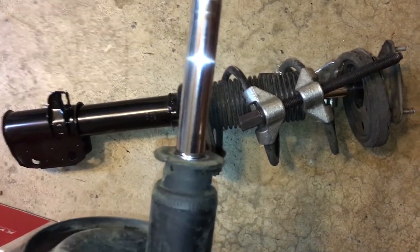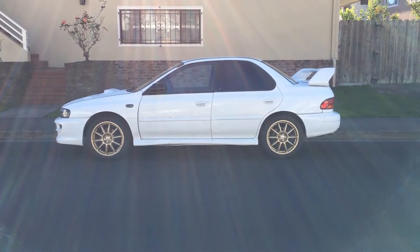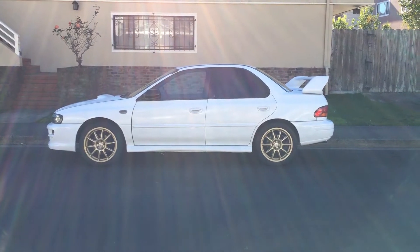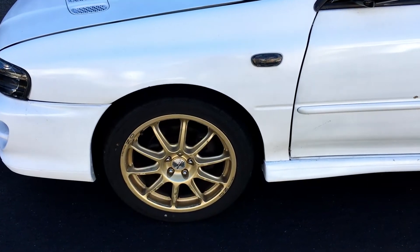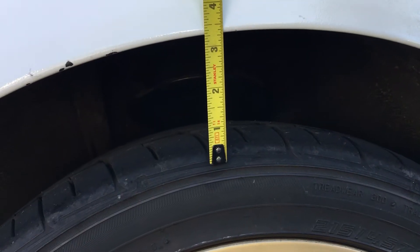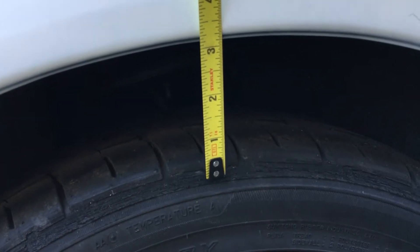Last night I finished installing the stock suspension with the replaced shocks, and the car is a lot higher now. I can stick about four fingers in between these gaps. Walking around to measure: it's about three inches, eight and a half, two and three quarters, thirteen inches, three inches, two and three quarters, and nine inches in the front.